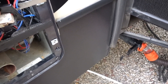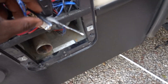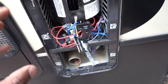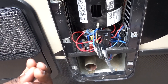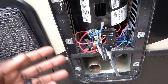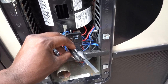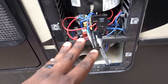Now that I have the sail switch out, I want you guys to listen and see if you can hear this. If you don't know what a sail switch is — I half the time don't know what it is either — but in layman's terms, it basically measures the airflow for the furnace to ignite. It's like a protector for the furnace, because you have heat from a live flame. The fan allows that heat to flow; otherwise it might build up enough heat to maybe start a fire. If this is not working, you will not have a flame for the furnace to ignite and warm your coach. So you want to make sure this is taken care of properly.